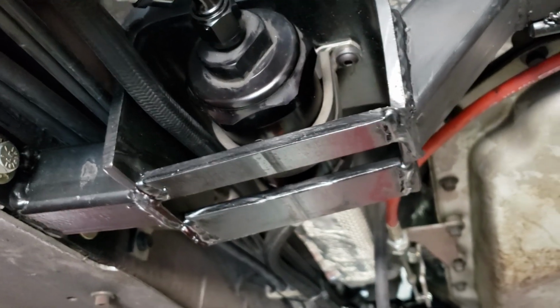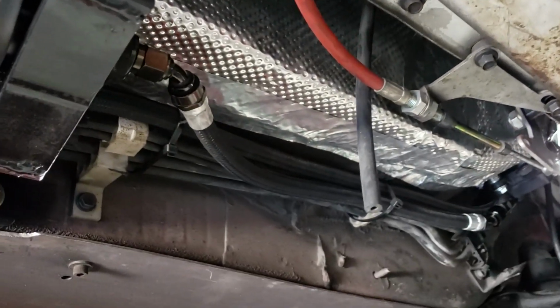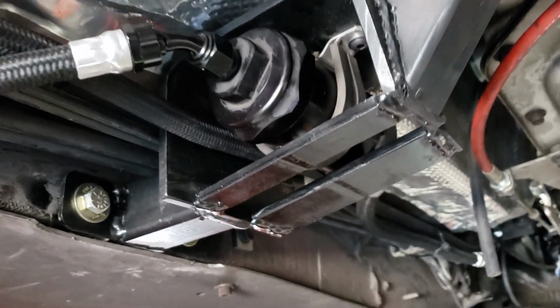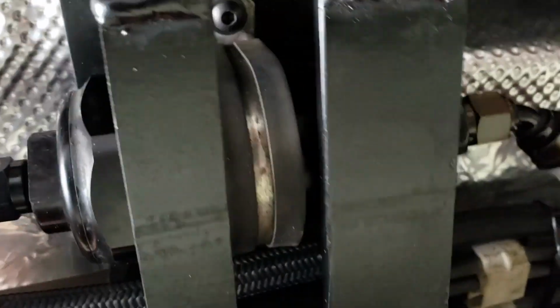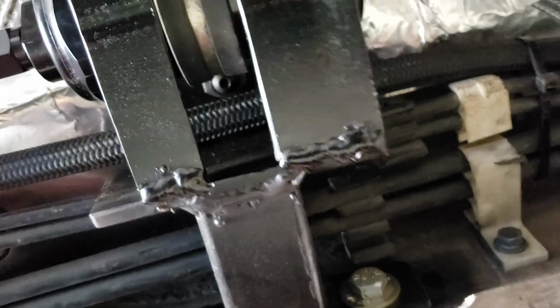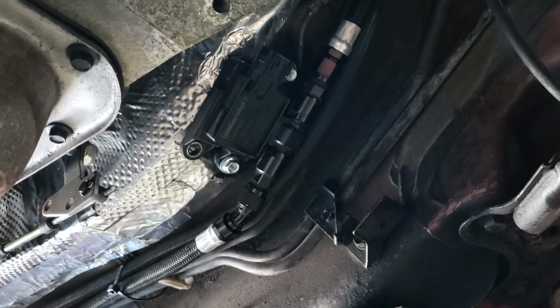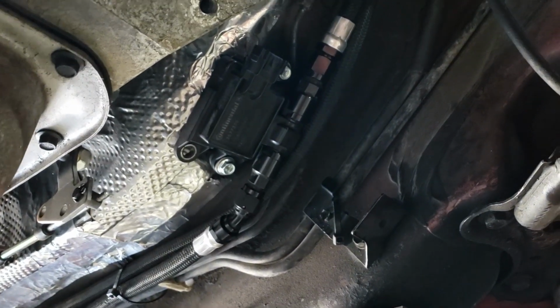So I put a fuel filter there. Instead, I relocated that like the other deal was on the other side. So ran that through there, made a small little ghetto brace, but you can still access the fuel filter bolt, so that makes that easier for me. I replaced the element with a microglass element. Up here, I relocated the flex fuel sensor. It was on the other side, just like everything else.